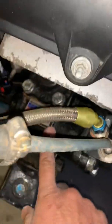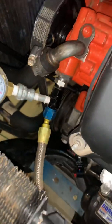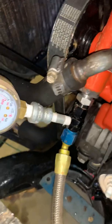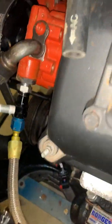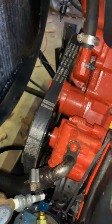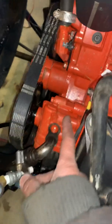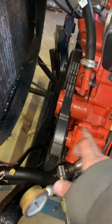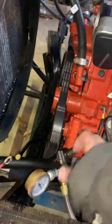With the Borgeson box it wants around 1,100 pounds of pressure. I think Ehrenberg said for the factory boxes, if you want good tight steering you want around 800 to 850 psi. This pump is off an 06 6.1 — factory for that year. I don't know if the newer ones put out more pressure, I read somewhere they do, but this is all the pre-09 pumps.